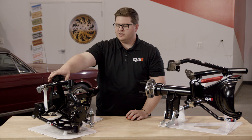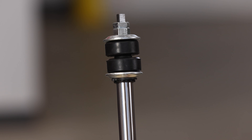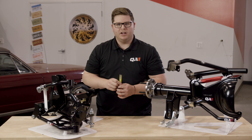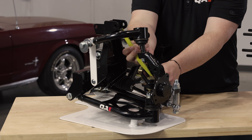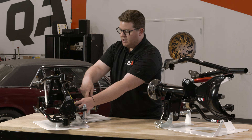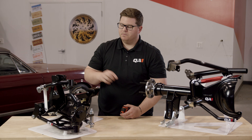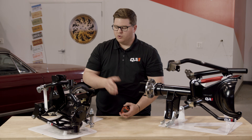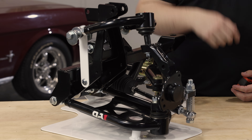Now on a front suspension of a stock car, you may have that stud upper mount and it can be a little tricky to feed that tape measure up in there. What we want to do is use a tape measure or just a welding rod that we can hold our finger on to index it, then run that tape measure up in there until it hits the bottom of that spring pocket on the frame. Run that tape measure down to the mounting location on the lower control arm, and from that measurement we'll probably take a half an inch off just for the height of that bushing. Or if you are measuring with a shock in place, you can just measure right up to that lower washer hidden up in that spring pocket.